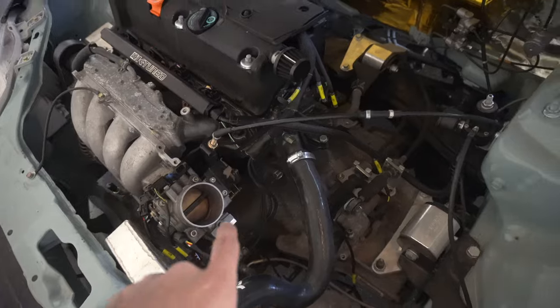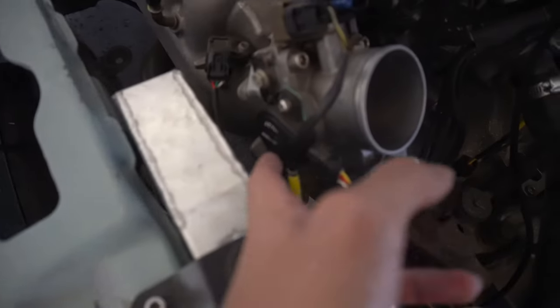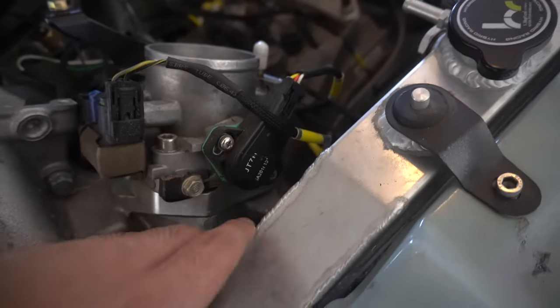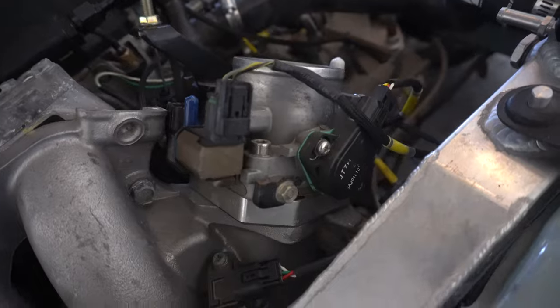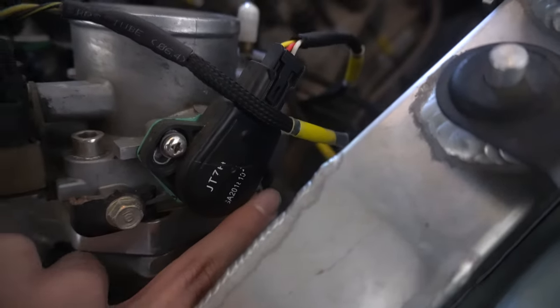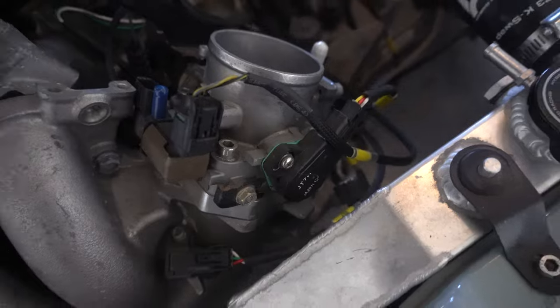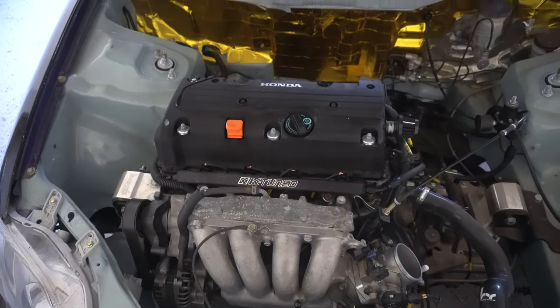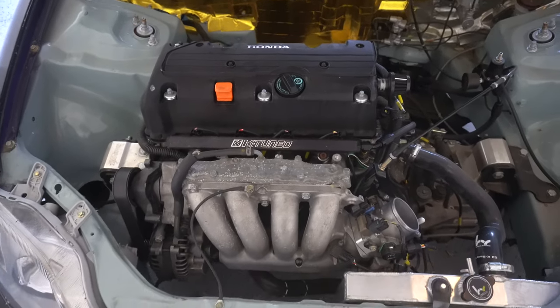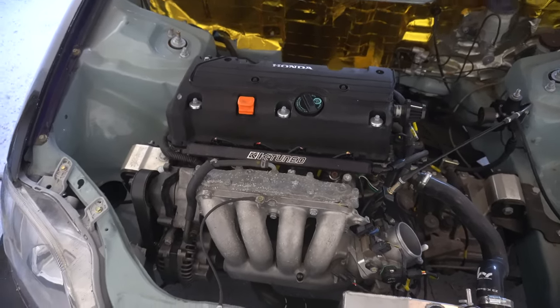Alright guys, I've been messing with the car — I messed with the screw on the throttle body and it didn't do anything to the idle. So now I'm gonna be adjusting the TPS, and KPro shows that it's at five percent — it should be as close to zero as possible. It's just a tight fit, I'm trying to find something that will fit in between the radiator to take off that screw. I'm gonna have to go to the store and get something that will fit. I was really hoping the idle was gonna be fixed, but we'll go to the store, come back, and try whatever — hopefully we get this thing running right and hopefully we drive it later.